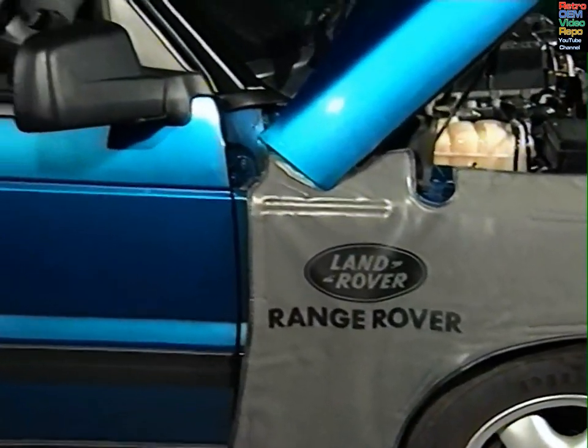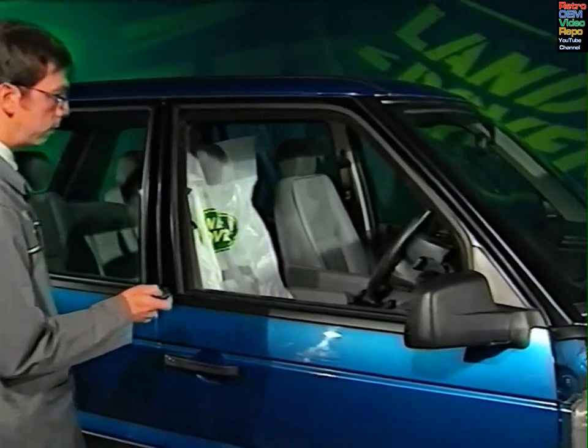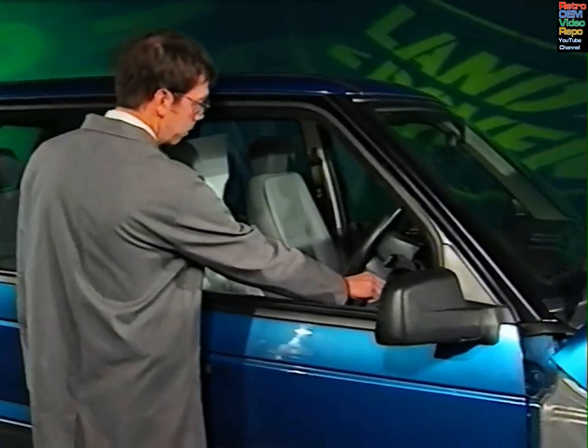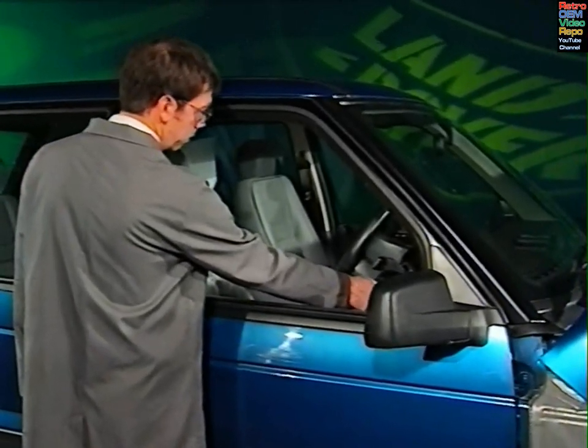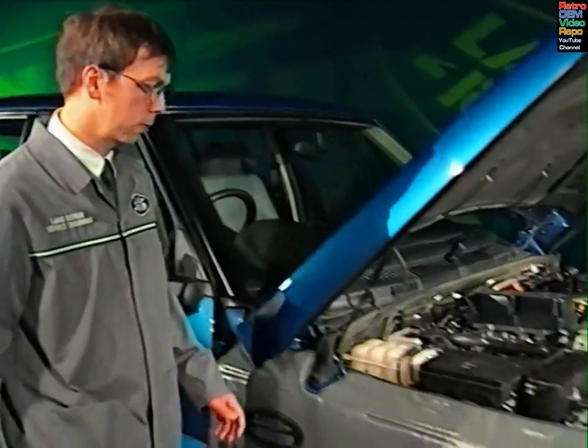Before you take out the old unit, make sure where possible that the security system is switched off. If not, the engine management ECM may be immobilized and the car may fail to start. Don't forget to disable the battery backup sounder. To do this, turn the ignition on and off, then disconnect the sounder within 16 seconds.